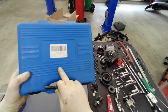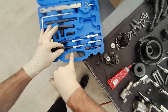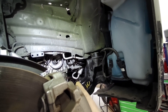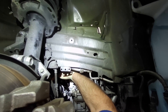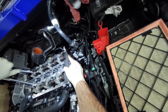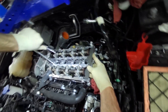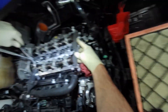There's my camshaft setup tool — I picked this up off eBay for about a hundred bucks. The first thing you want to install is the crankshaft locking tool 303-748. You pull the plug out of the back of the block — it's right in front of the right half shaft, so you've got to pull that back a little bit. Go ahead and tighten that up. Next, I'm going to insert the camshaft alignment tool 303-1552. I like to rock the camshafts until I find that sweet spot in the middle so the tool slides in easily and isn't bound.